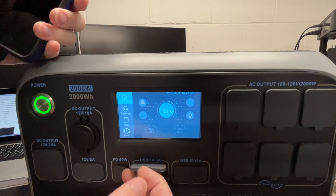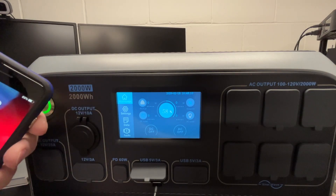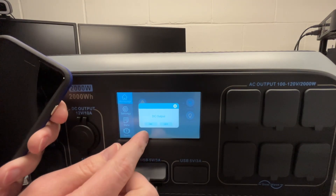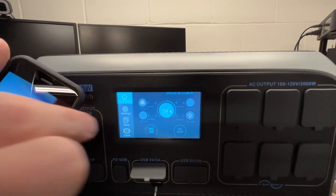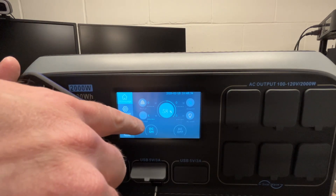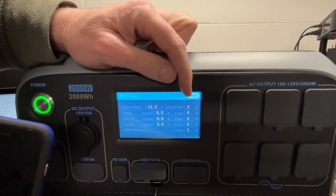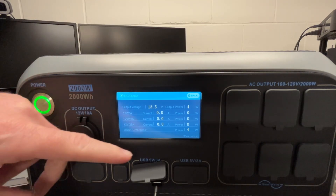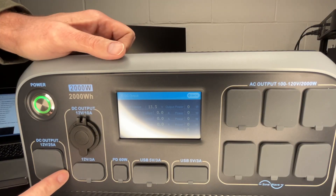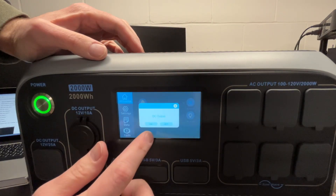I have a phone here and I'll plug it into the USB port. It's not working right now — the device is not charging. I need to hit DC off and then turn it on. This is kind of hard to see from up above; I had to put my head down to see it. There's not a lot of contrast and I need to hit on. After a while you'll just learn where the buttons are. Now it's charging — it's using 4 watts of DC. We can tap on that and see all sorts of stats: output voltage is 13.5 volts, output power is 4 watts. These are for the 12-volt ports. If I unplug the phone, it drops down. So to use the DC outputs or USB, you want to use DC mode. Hit back in the upper right to return to the main screen, then hit it again to turn it off.